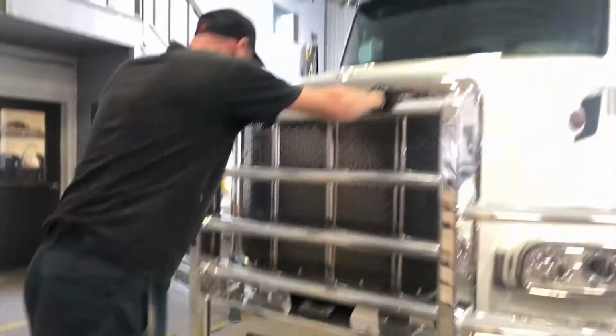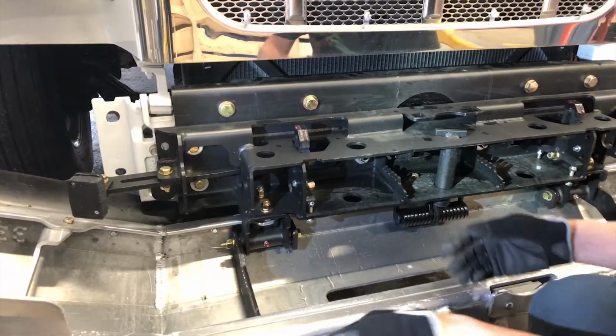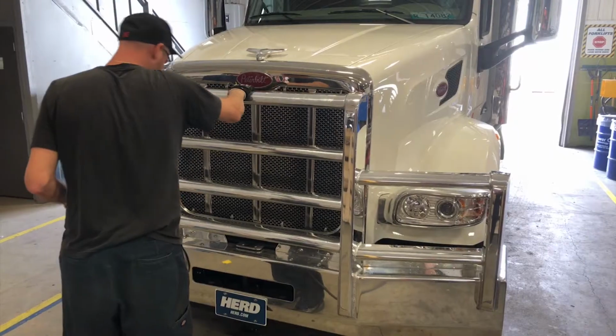If you cannot open or close the handle, you may have over-tightened the adjustment. To fix this, lower the front and raise the back adjustment bolts. Tighten the top and bottom bolts to 110 foot-pounds. Your adjustment is complete.